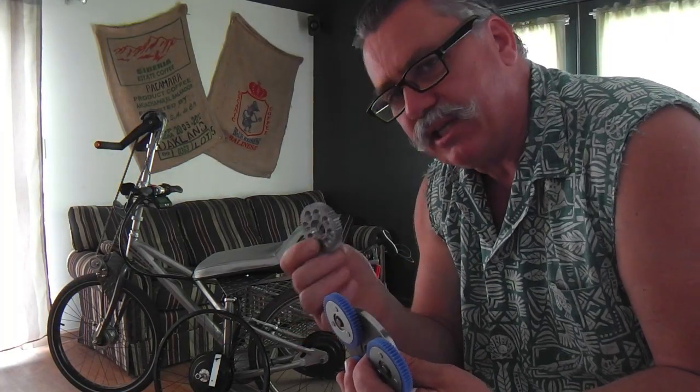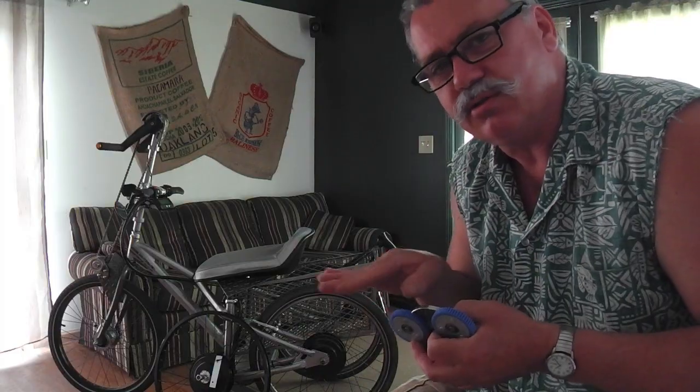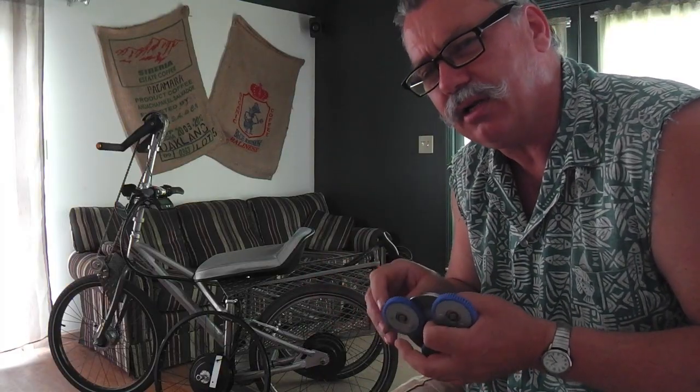This will add a little noise to the mechanism. These geared hubs are not quite as silent as the direct drive hubs, which have no moving parts — just magnetism going round and round. The geared hub actually has a bell housing, so there is a little perceptible noise. Maybe not enough to wake every dog, but it can let people know you're coming, which is also good — you don't want to run up on people in super silent mode. I kind of like that there's a little bit of noise from this.